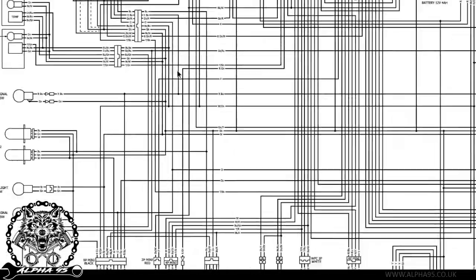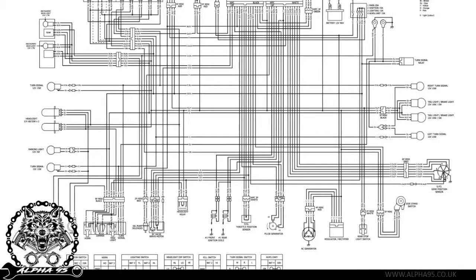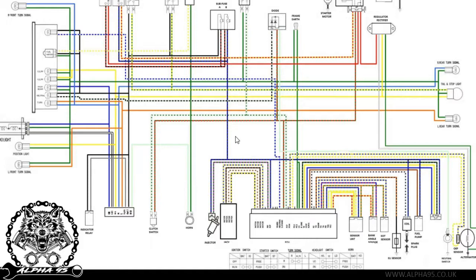So this is really the best way forward instead of jumping straight into a motorcycle — if you have a wiring diagram that you have or that you can get quite easily, this is by far the best way. I will cover more on wiring motorcycles hands on, on the bikes, and what I'll do is as I'm going through it I will show where I'm reading on these wiring diagrams and how I'm finding what cables I need, plus show the use of double checking things with a multimeter. Although majority of these wiring diagrams are accurate, you can get the odd one that is just a cable off, and that can be enough for you to be popping a fuse or something not working and you're sitting there scratching your head because you've followed the entire wiring diagram. So I will cover all of that in future videos very soon, because I've got many projects I've got to finish over the winter.